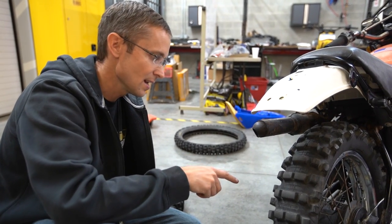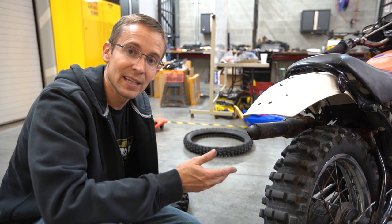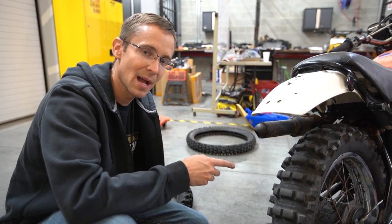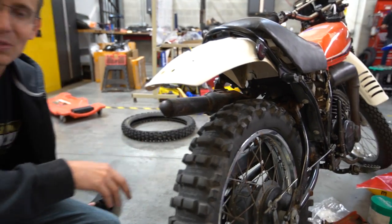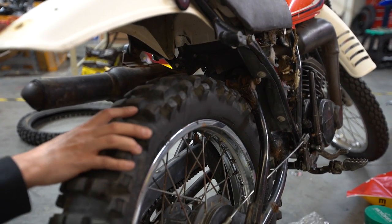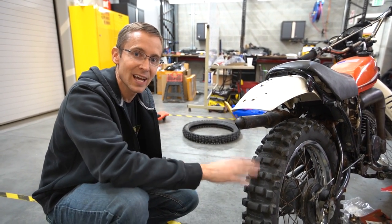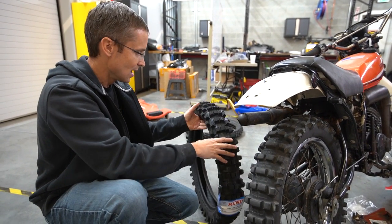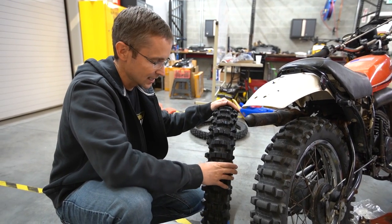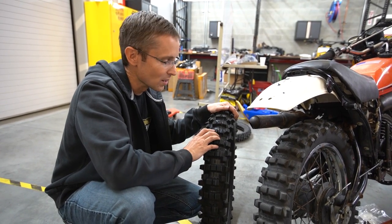The chain had been adjusted all the way back with no more room to adjust, so I thought it'd be a good idea to take a couple links out. I did that, put it all back together — now I have plenty of adjustment. But the problem is this fat tire rubs the swingarm, so it hardly even rolls. I took it for a spin and it started smoking, so this tire is not going to work. Luckily I have a little bit left in the budget, so I got the Kenda Trackmaster — a lot skinnier tire. I'm a little bummed I had to buy a tire, but it'll be nice to have some fresh rubber.